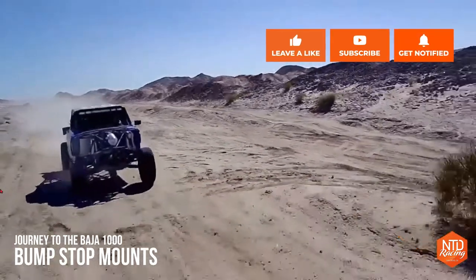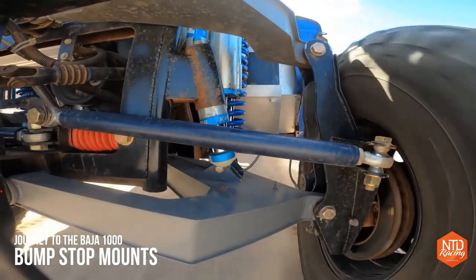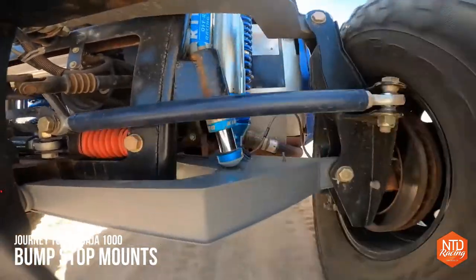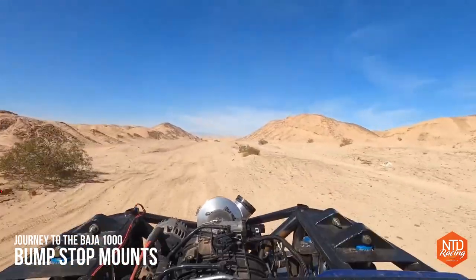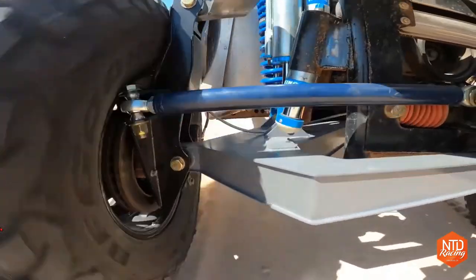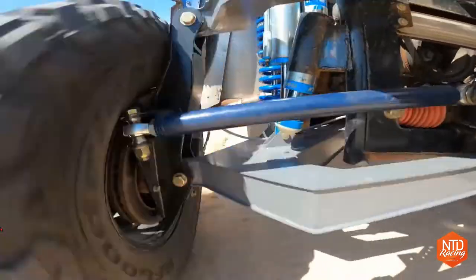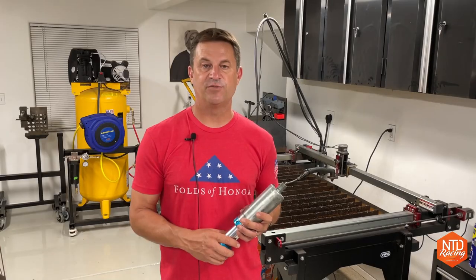You might be asking yourself why are we moving the bump stop? Right now our bump stop lands midway down the lower A-arm on our front suspension. By moving the bump stop to the end of our upper A-arm, we're going to give ourselves a lot more clearance for the motion of the suspension, basically giving us about four more inches of downward travel. More importantly, we will reduce the stresses on the bump stop by about half, allowing the bypass shock to do more of the work it was intended to do, and then only contacting the bump stop in the last two and a half inches of suspension travel.